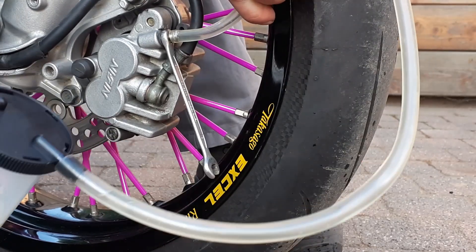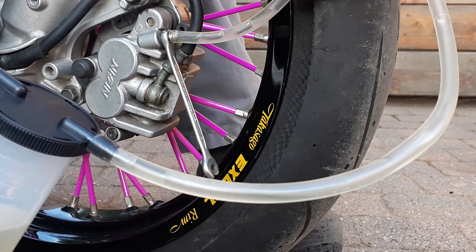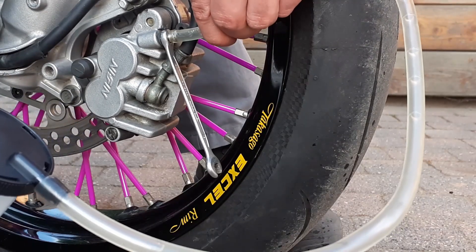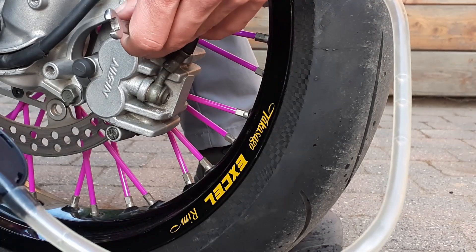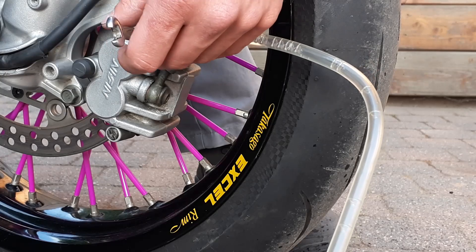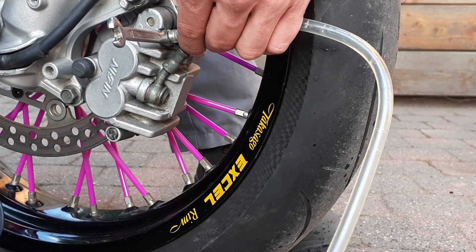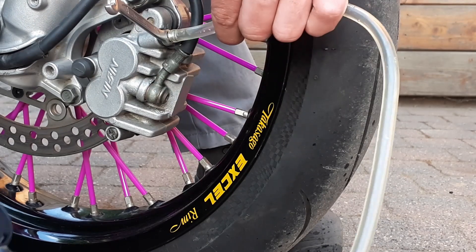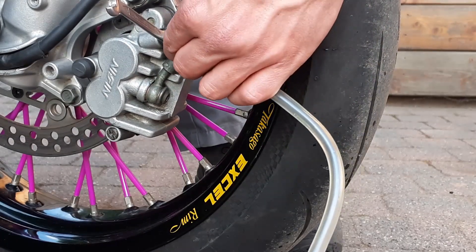I don't prefer this process because fake air can come into the tube and then you don't know if the system is fully bled. Just close the bleeding screw and disconnect the tube. Don't forget to fill up and close the reservoir.